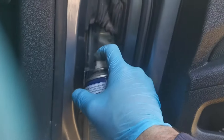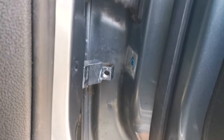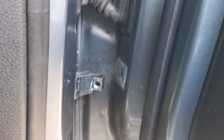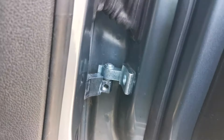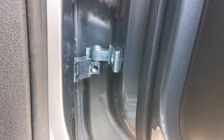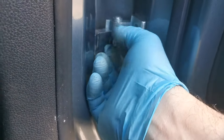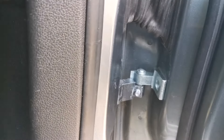The next job is to clean it all up. I'll use a bit of brake cleaner. Just give it a quick clean, because you don't want that pin turning — I want the hinge to swivel, not the pin. Get the new hinge, put it in place. There's a lot less play in that one. Personally I use the new grub screw because it's less worn and it's dry, so it's not greasy and it's not going to spin. Put that in and then tighten it down.